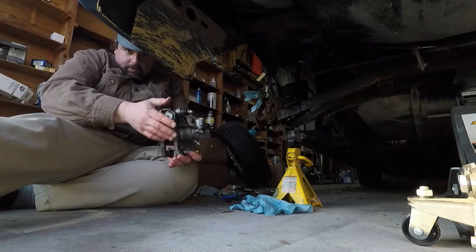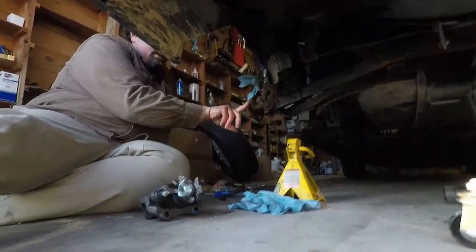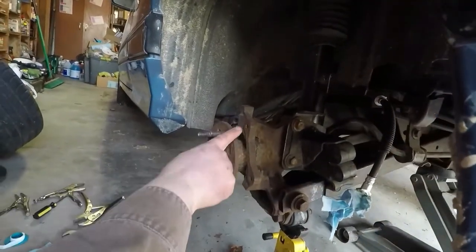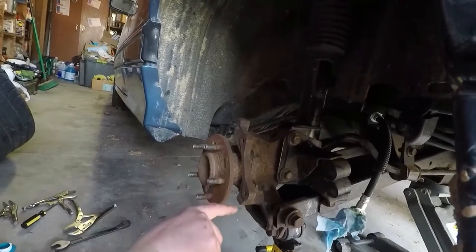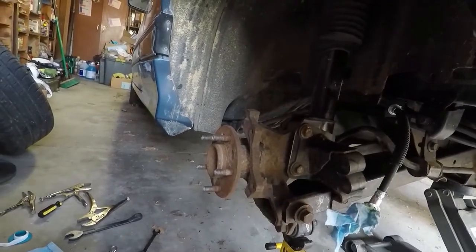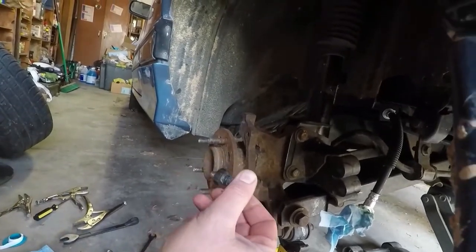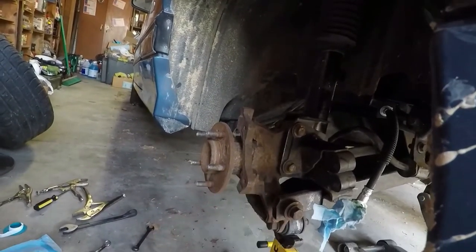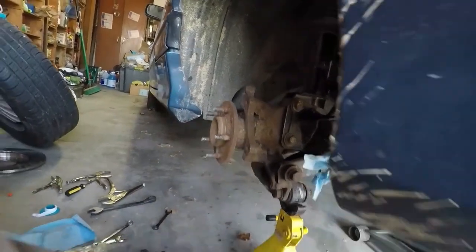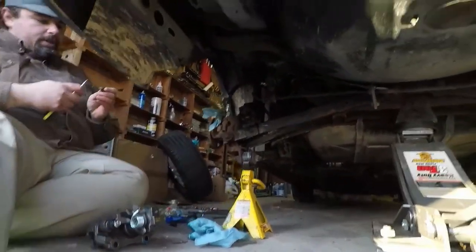You're showing me, not the people here. Oh, so it's not on this, because this had no threading. But on this piece here, where the end of that screw goes in, that's where they lock up. So I'll put a little bit of anti-seize on the end of these, and then thread tight on the bolt, which not only keeps it from backing out, but also helps keep it from locking up. But you can see where corrosion formed on it. So I got to clean it up. Clean, it keeps the corrosion out of the threads, you're saying? Yeah, it helps keep the corrosion out of the threads.